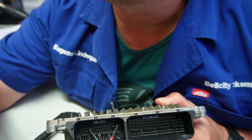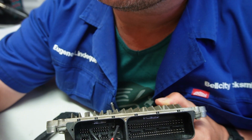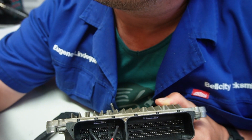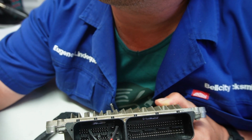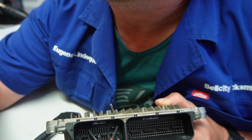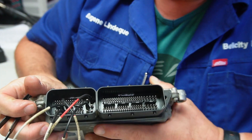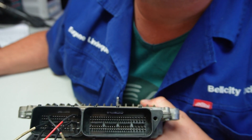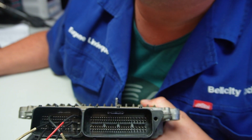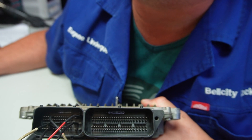It's very important to make sure and double-check that you've made your connections in the correct positions — for obvious reasons, you don't want to mess up there while you're testing it. And don't forget your CAN high and CAN low wires. Just go through it a second time — I always go through it a third time.